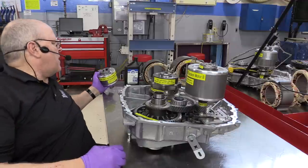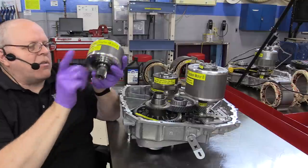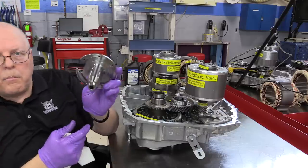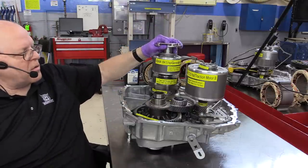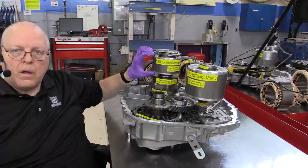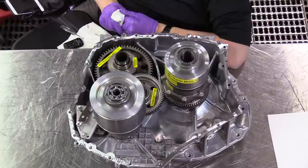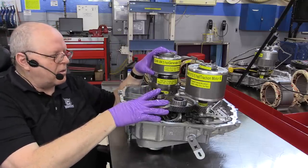To install the snap ring, I reach in, find an oil lubrication hole and lift up on the planet carrier assembly, then get the snap ring in place. We've got the snap ring holding the planet carrier to the power split ring gear and motor A drive gear or counter drive gear assembly. The last part to come in is the motor A assembly itself with its sun gear for the power split device, and the bearing support and input shaft support assembly that comes through from the other side of the case.